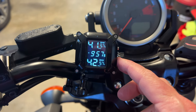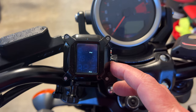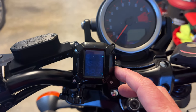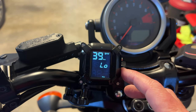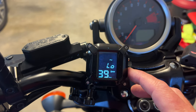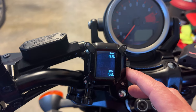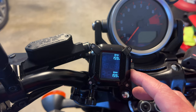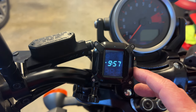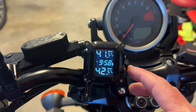To get into the menu all you have to do is hold this button for a few seconds and it lets you into the menu screen. I'll cycle through just to show you the options — I'm not going to change the thresholds at this point. Right there you can see you can adjust the PSI or change it from PSI to KPA. There you can change the unit of measurement for the temperature. Here are the thresholds for the low side — I have the front wheel at 39, and on the high side I now have it at 51. Here's the rear wheel — lower end 39 PSI, upper 51. There's the temperature, which I think is by default at 159 degrees Fahrenheit. I didn't really mess with that, and there's the low end — I believe it's 69. And that's how you set the clock. Then that gets you back to the home screen.